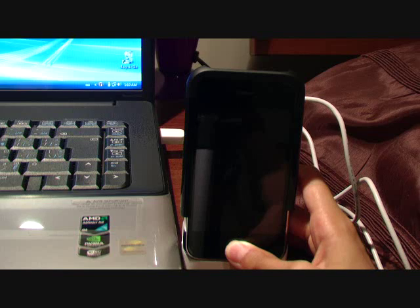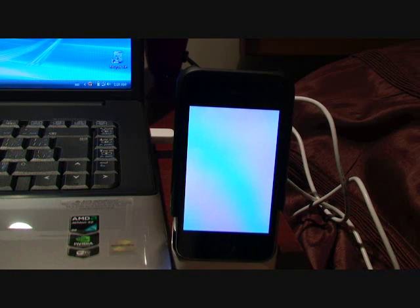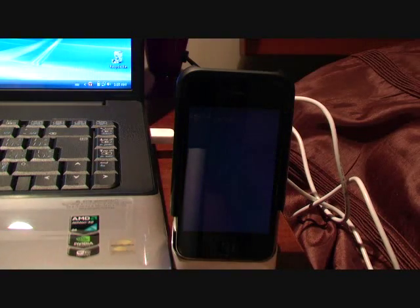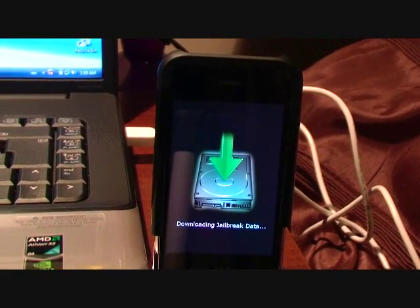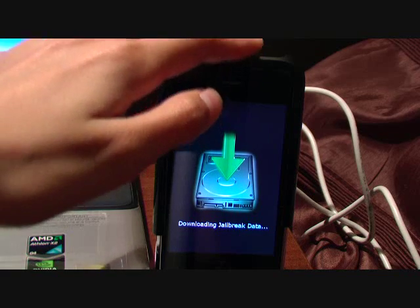It's fairly simple and it counts down for you. This is what it should look like — it says 'Waiting to reboot', the screen turns all white, which is normal. It's the same for iPod Touch and all that. It then says 'Waiting for reboot' and starts downloading jailbreaking data. Remember, only Cydia — all the links will be in the description, including the RedSn0w link. Do not unplug it until you can slide to unlock.